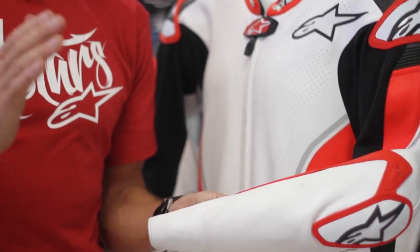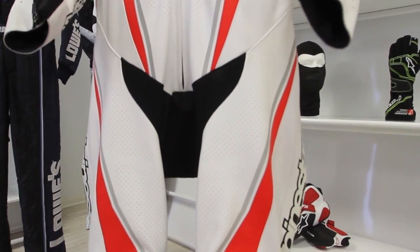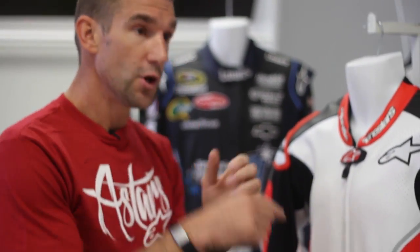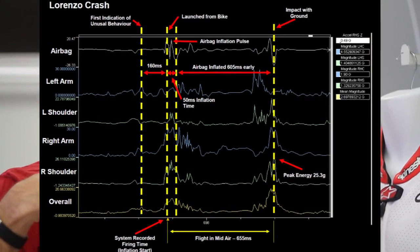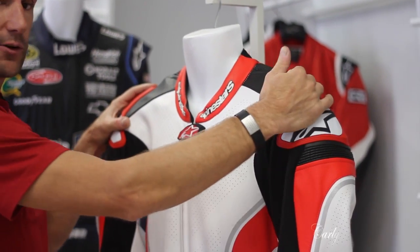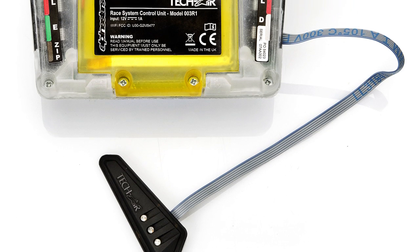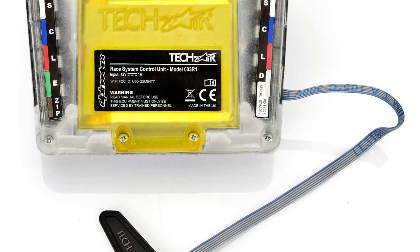These sensors are three-axis accelerometers — very precise measurements. It measures the force going through the suit, looking at your body position, whether it's cornering or your foot's come off the peg. You see a lot of MotoGP riders taking a foot off coming into corners — you'll see a spike in the data if you download the suit. So it's measuring all those energies and forces. It sends a signal every two milliseconds to the ECU, and the ECU has to go through certain parameters before it will deploy, because we don't want any false deployments.